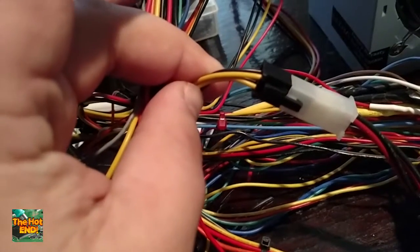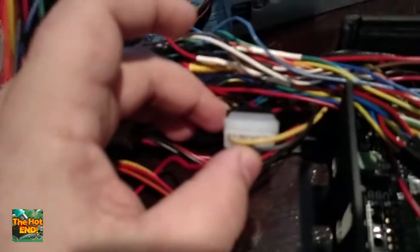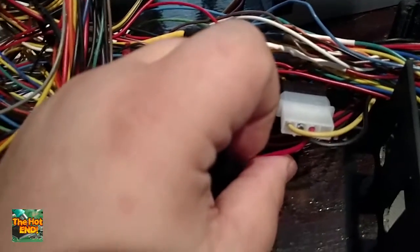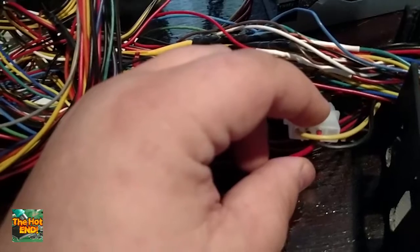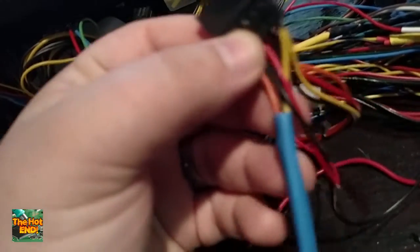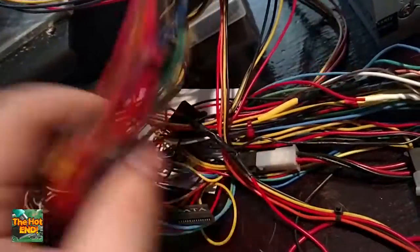You can take a regular Molex and that's going to provide 5 volt. Now this one was odd — whoever made these screwed up the coloring of the wire. This red wire here is actually a ground pin; it's supposed to be black for ground. Yellow is 12 volt, the two middle ones are ground leads, and the 5-volt pin is not populated, which is a real pain. So what I did is I took one of your SATA power leads — because they provide power for hard drives in a computer — cut the end off, and ran it so that we'd have 5 volt from one of those SATA connectors. Right back here I've got it wired into a 5-volt lead which provides 5 volts at the main.